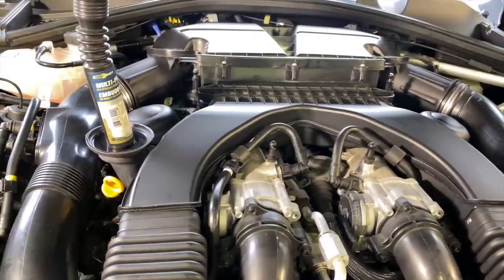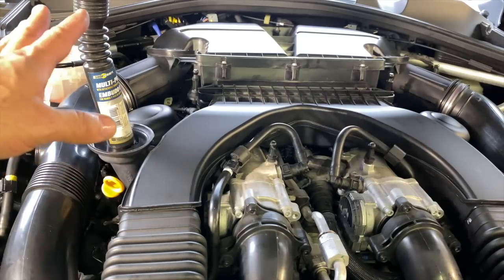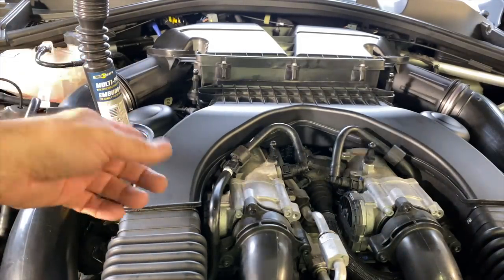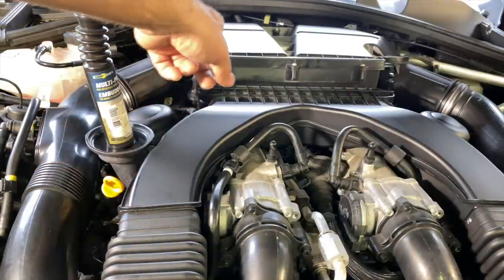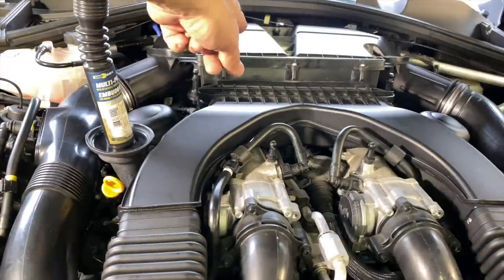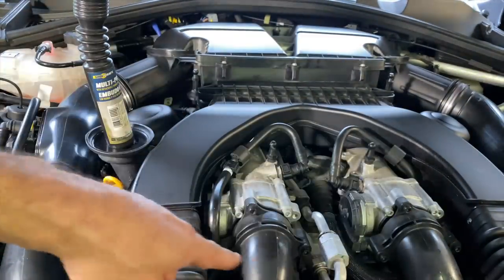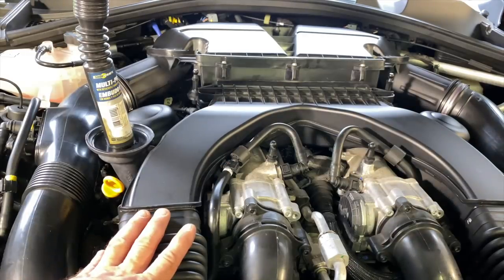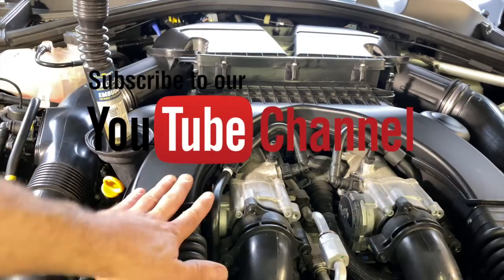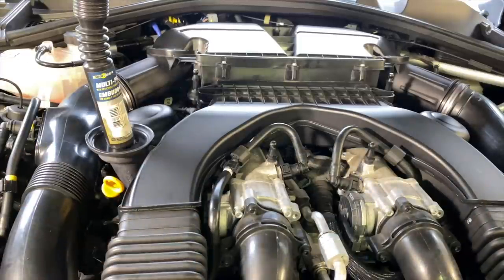Remove the funnel, put the cap back on, start it up, go for a drive, and check it again. Hope you guys enjoyed this video and learned some tips and tricks. I highly recommend doing this yourself if you own these cars — under $200 and about an hour to do it this way, or 20-30 minutes if you extract from the top. Remember: yoga block, disconnect the line off the clips in the back of the airbox plenum, 32mm for the oil filter, 13mm for the drain plug, T30 and T25 for the underbelly hardware. Index the plug, torque everything, clean up, and you're good to go. This is the sixth oil change on my 2018 Giulia Quadrifoglio in three years.